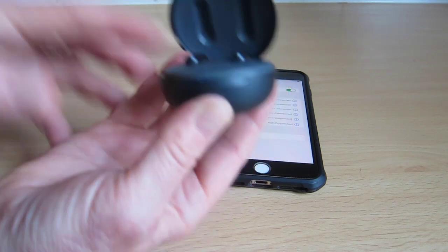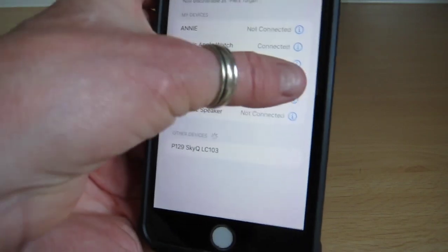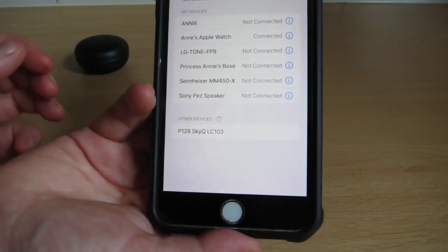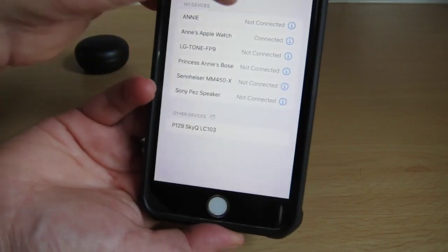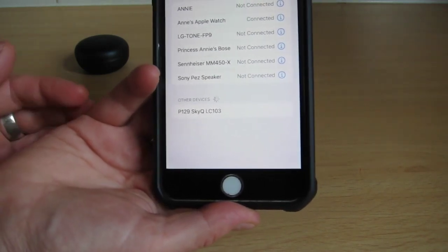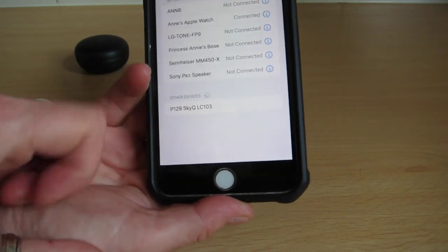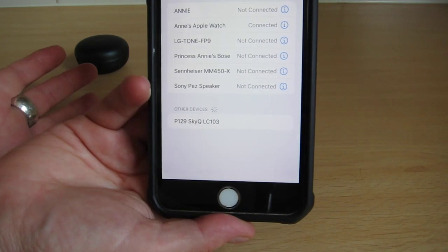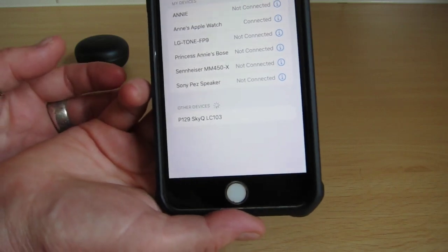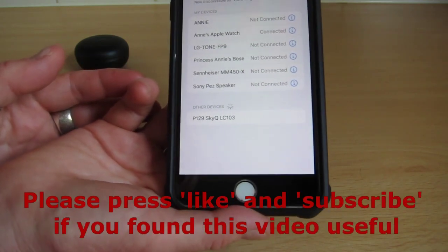What this will do now is, if you look on your Bluetooth connection, it will have disconnected the earbuds. So all you need to do now is reconnect them. What it will probably do is, when you try and reconnect it, basically turn off your Bluetooth, turn it back on, and it will start appearing. It will probably say 'forget this device', so forget the device. And then it will appear as a new device, which you then connect to. This has worked for me numerous times — you should have a new earbud which works perfectly for only £25, rather than having to scrap the old earbud and buy a new pair.